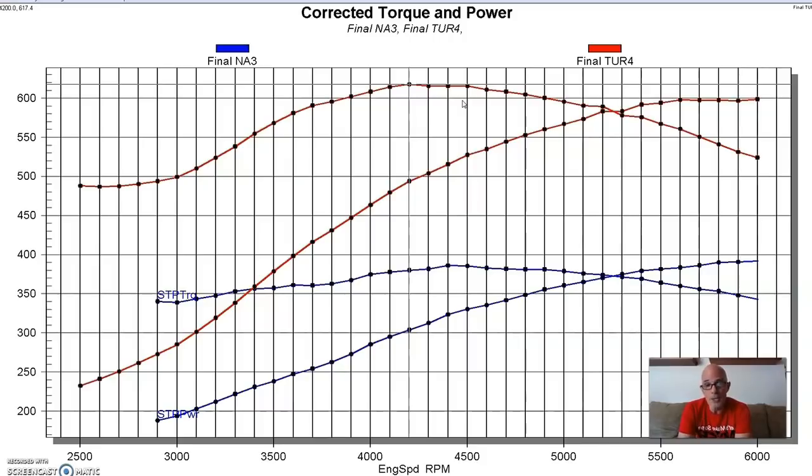Good combination, good power from the turbo. But down at 2500 RPM, the turbo benefited from something it will probably never see on the street - the load imposed by an engine dyno. When we roll into the throttle at 2500 RPM, we've got a stationary load on the engine and then release it, experiencing something it will never see on a chassis dyno, out on the street, or at the track.